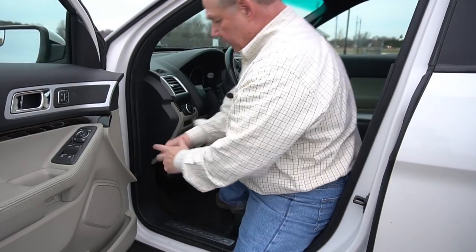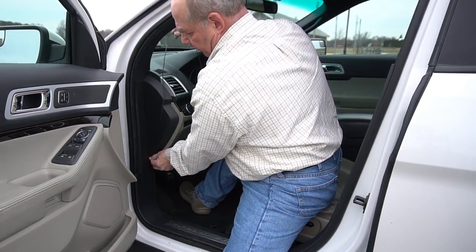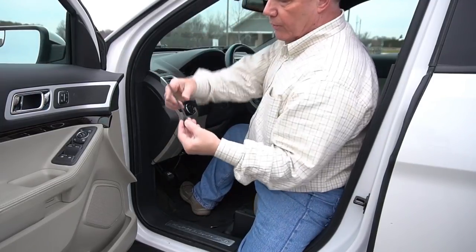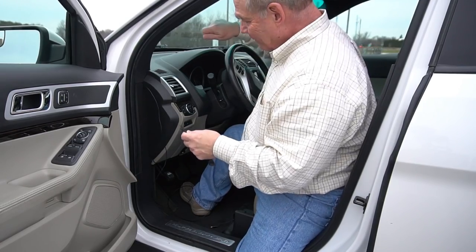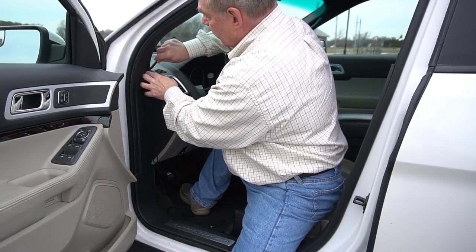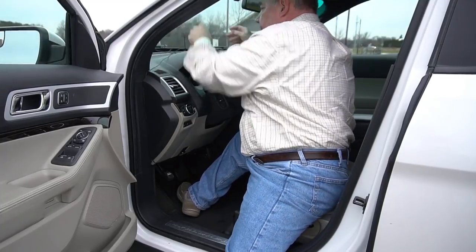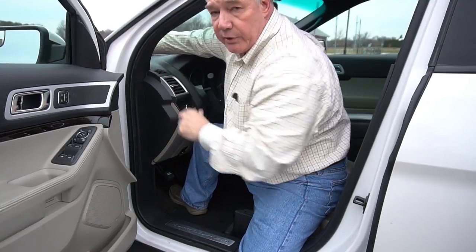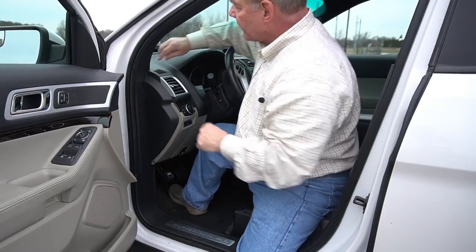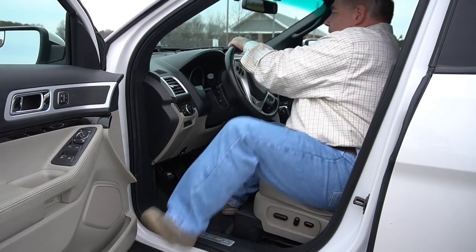The next step is to route the wiring around the edge of your dashboard and up to the center of your windshield. Just pull it tight along the edge and tuck it in between the dashboard and the molding — it'll be easy in some spots and trickier in others. Up near the top it gets a bit tight, and that's where the tuck tool is genius. Gently insert it between the dashboard and molding to create just enough gap to get the cabling in. It gets much easier once you reach the windshield. Leave the extra cable up there for now — I'll clean it up in a minute. I already started the timer, so I'm playing beat the clock to see if I can do it in under five minutes.